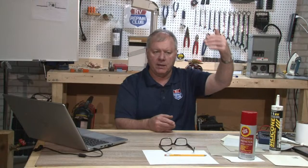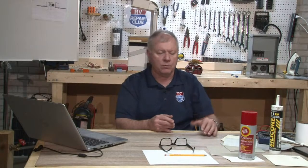So that's where your question is. Really you have two 12-volt banks. I can get the exact same amp hours in two 12-volt batteries that are rated at the same amp hours. Now the advantage of the 6-volt battery is that it will last longer, meaning more cycles. Every time I drain it down 50%, bring it back up, drain it down 50%, bring it back up, you're cycling this thing. And with the 6-volt battery, you have more plates, more cells, more cycles. So it should last you a lot longer down the road if you take care of it.